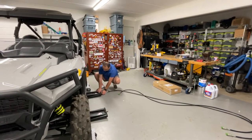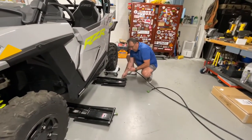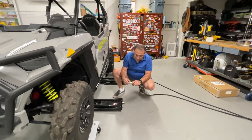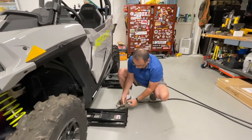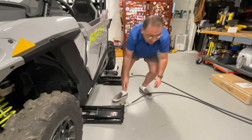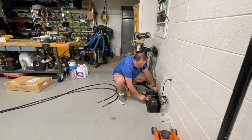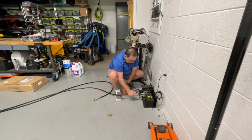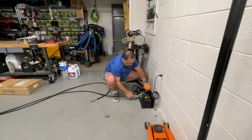One of the things I love about these quick jacks is they're hydraulic — they use transmission fluid in the quick jack unit. I've had these for a bit and this is one of those investments I wanted for years and never did it. I just talked myself out of it, and once I did it I thought, why did I not do that before? They're the leak-proof fittings. Connect your hose to it and once it's up on quick jacks with the safety bars it can stay there indefinitely. We've had this for several years. Sometimes the fitting gets a little stiff on this end, but it's just a press fit — sometimes you got to hit the down button as you do it and it pops right in.